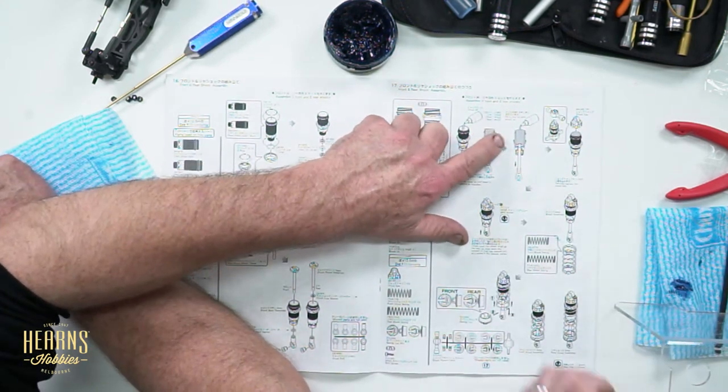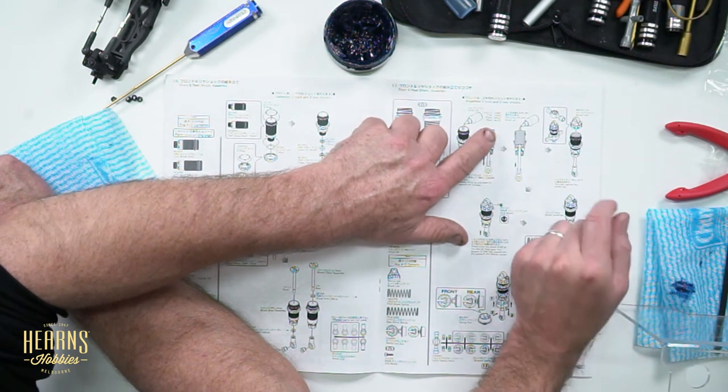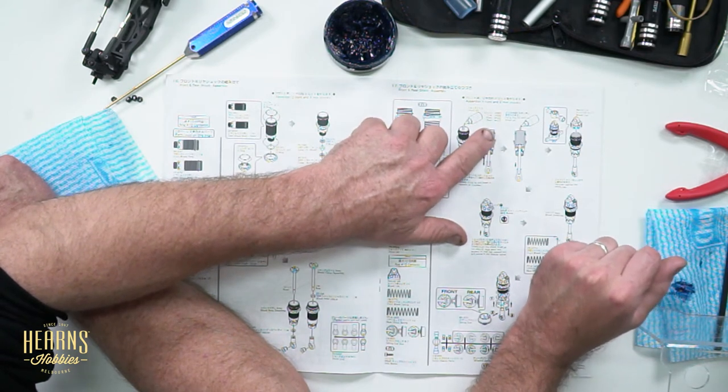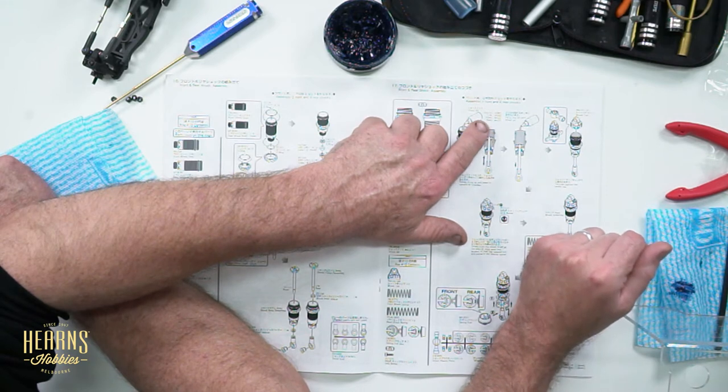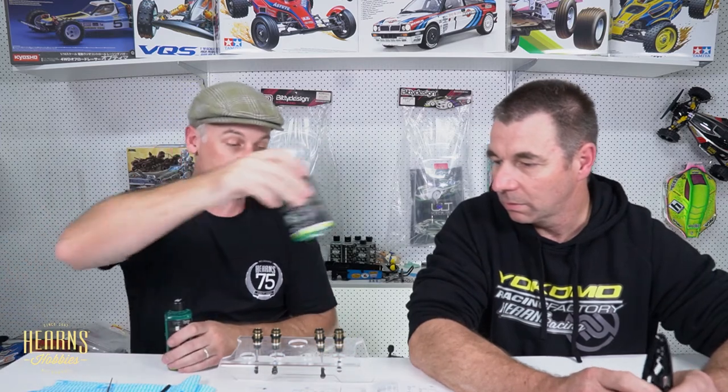So this one here, see how the Japanese run lighter oil. Yeah. But it's CST, it's not WT. We've got WT, right. So it's 450 front, 400 rear. And CST is really the metric way of doing it, isn't it? It is. WT is the old school. WT varies between brands. CST is a standard measurement. And they're both a viscosity of the oil, which is its resistance to move. Yeah. A measurement. So we'll go 32.5 front. 32.5, you can do the rear ones while you're over there.